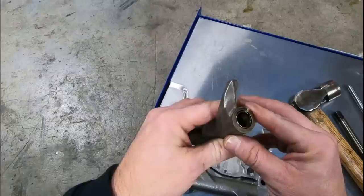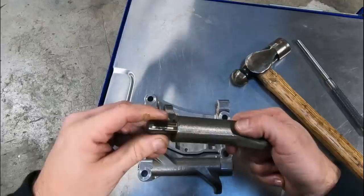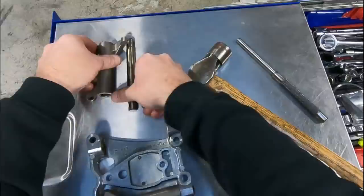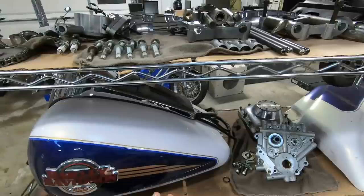Now let's take a look at the bushings. Bushings look pretty good in there. Let's give it a trial fit — nice and smooth. A little bit of a burr edge there; we'll probably burr that down. But the bushings inside feel good — not a lot of slop, not a lot of play. That's how you check those. Next, let's take a peek at the breathers. These have been upside down and draining, so you don't see any oil in here, but we also don't see a lot of particulate and sludge. The breathers are actually relatively clean — that's a good thing.